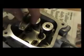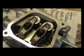These springs are a little tricky to get on. You can use a wrench for the 26 pound spring to compress it. Next, install the HP lash caps, the rocker arms, and the rocker arm guide bolts. Thread these on by hand.